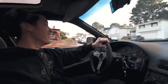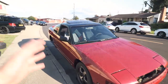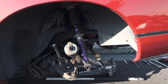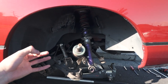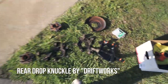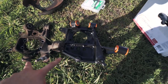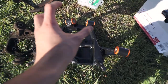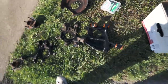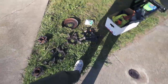Oh my god, I just got shot when I went back to stock suspension. If you go low, stay low — don't go back. Taking a closer look: the drop knuckle itself has coilover mounts right here, about the same distance height-wise, but the hub is more upward than the stock one. The arms will be in the same place, and this should help a lot with correcting geometry. I'll need an alignment after this.